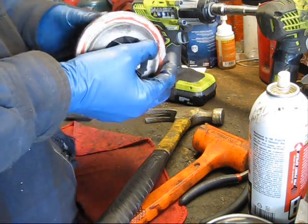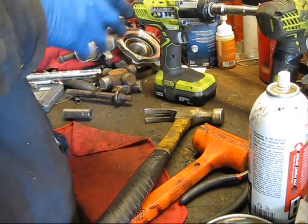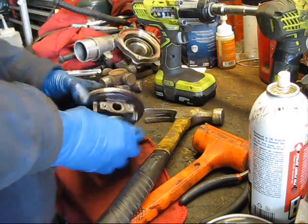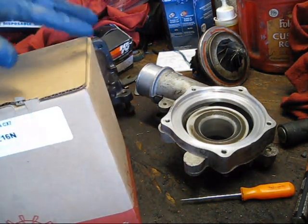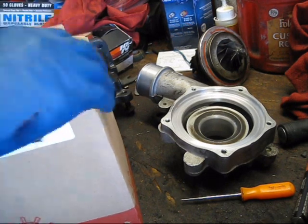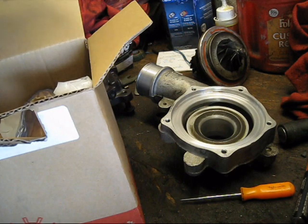So we're just going to get a whole new turbo cartridge mounted in the old housing. That's going to save me a lot of time and energy anyway. So now I got to go ahead and order said cartridge. Okay, so our housings are all cleaned up in preparation for the new CHRA, which is right here. Now this is from Rotomaster, and the part number will be in the description, which I have taken this out before, but then I put it back in for safekeeping.